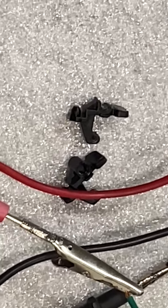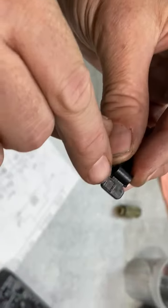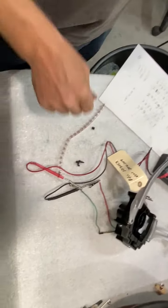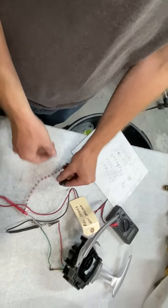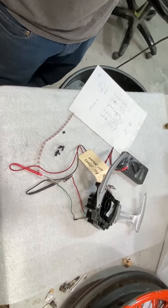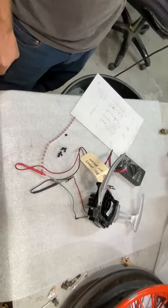And I should mention as well that the original pieces actually have a timing calibration on them that's nothing more than a piece of sticky tape. We have been able to eliminate that sticky tape by calibrating each one physically to the switch assembly, by filing and removing additional material on our casting. So there's no chance that it'll go out of calibration as a result of dropping a piece of sticky shim material. In any case, is there anything else there?